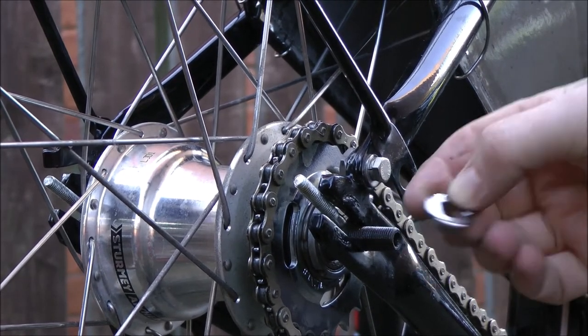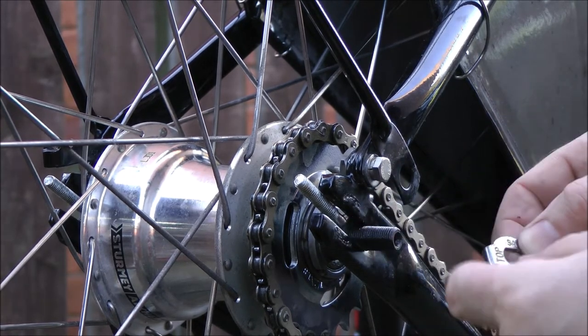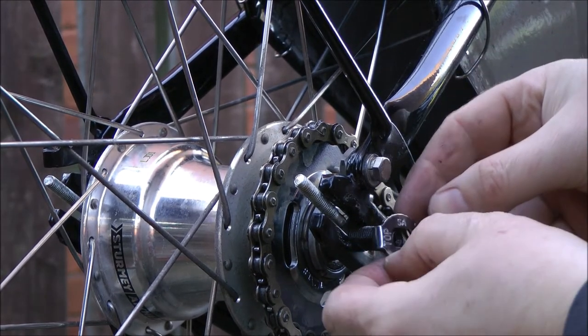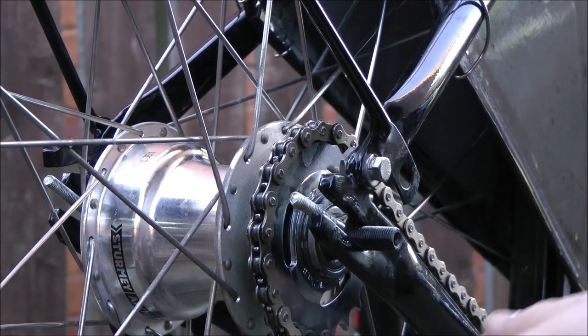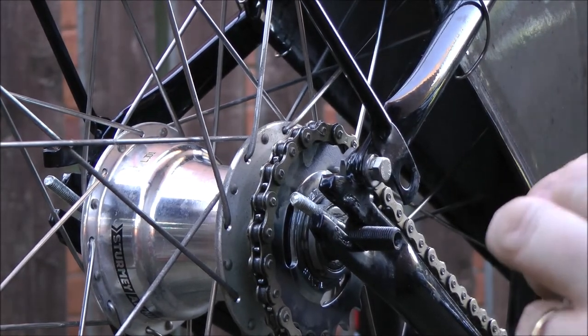So you should be able to see I've got the wheel in place. I've put the chain tugs on either side inboard, and hopefully that will be clear enough not to interfere with the chain guard. It's worth pointing out that normally if you change the size of a cog you'll have to adjust the chain accordingly. A two-tooth extra equates to about half an inch, and you can see where the original was — it's going to fit. Let's get the chain on.